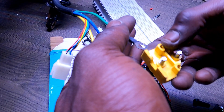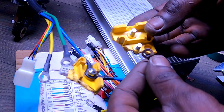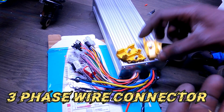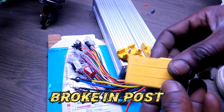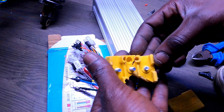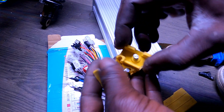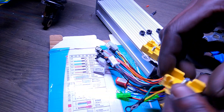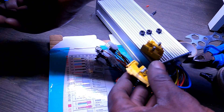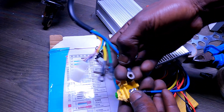Start with the motor wiring — simpler. You've got three thick phase wires: blue, yellow, green. Match them color for color like preschool. To connect the hall sensors, the connector came in the package but mine snapped — it's meant to be one piece on both sides. Starting with the blue wire, slot it right in, then from the motor side use the same color again — blue on.